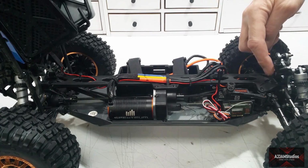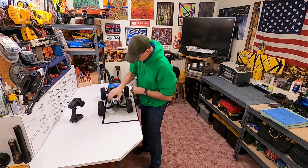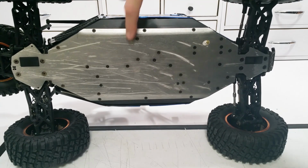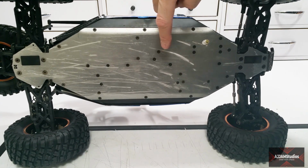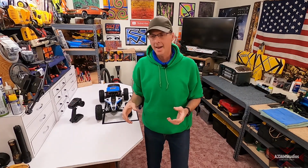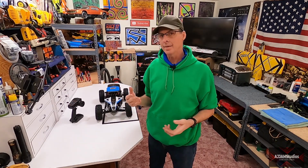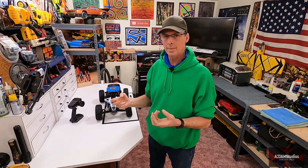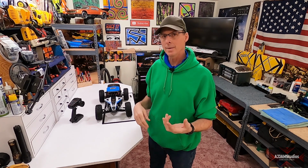There are 5 screws up front, and then when you get underneath it, there are 4 screws here. So there's 1, 2, 3, 4. You pull those screws and everything comes out in your hand. It's pretty simple to work on, and taking it apart is just like every other differential. You got 4 screws that you pop loose, the differential comes apart, and you can see what the problem is inside. And the problem was real.